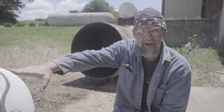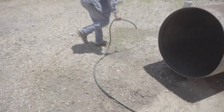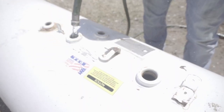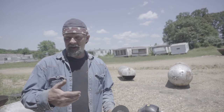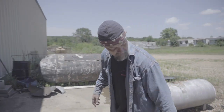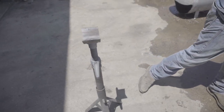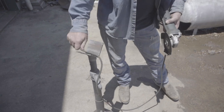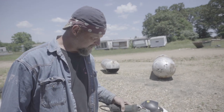On this one here, there's a warming cabinet and a firebox, so you really don't need this notch on there. We're actually going to come right here on this seam and just follow this seam and cut this tank off. So now we're filling this thing full of water, because if it's full of water there ain't no flammable vapor in it. The safety precaution here is there is water in this tank and you're using something with electrical power, so you want to make sure you're on a GFI outlet of some kind. I use a stand and I literally put my extension cord around it and fasten it with a clip so I can make sure it won't land or lay in the water.